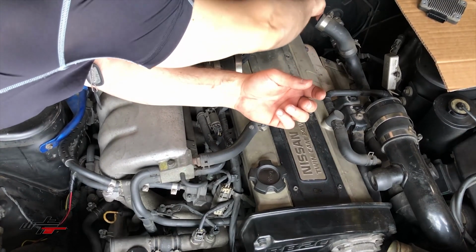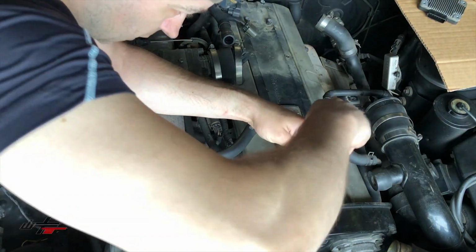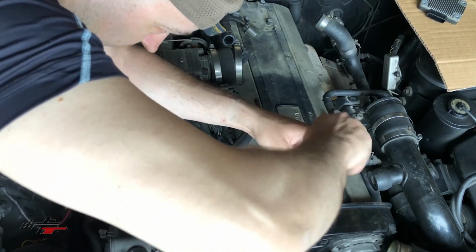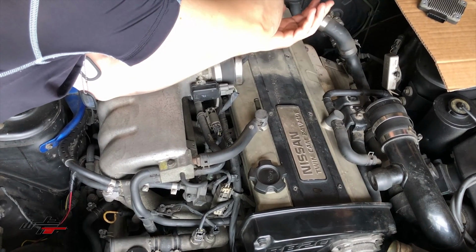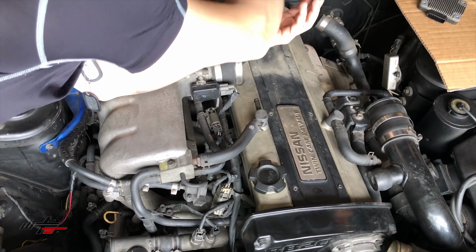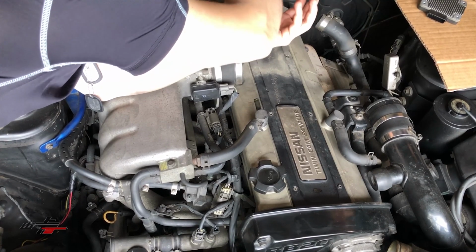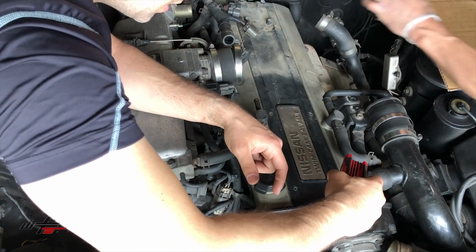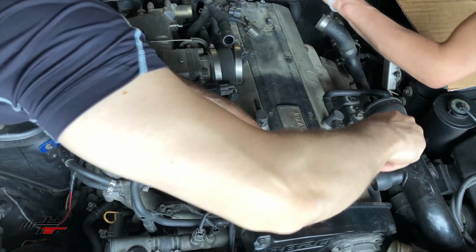You can tighten those two rear ones down, and put the igniter back in and then hook everything back up. Find those bolts. And these also don't need to be too tight. There you go. Quarter turn after contact. Exactly. It's all aluminum. Perfect. Okay, so there's a little arrow on them, and the arrow should point forward.